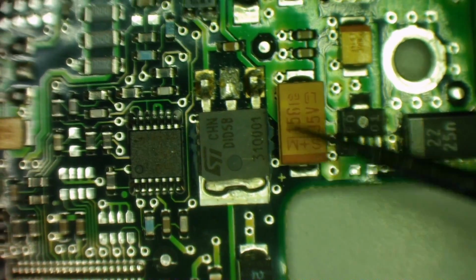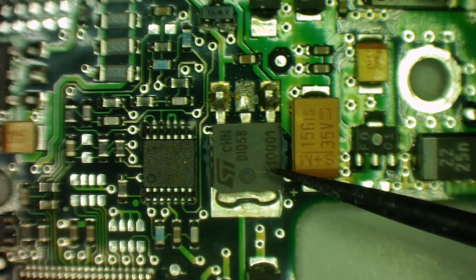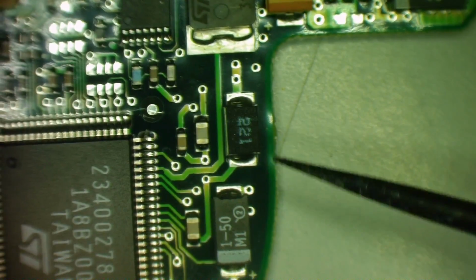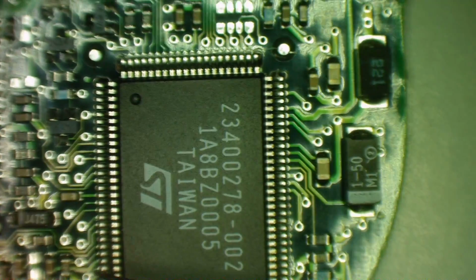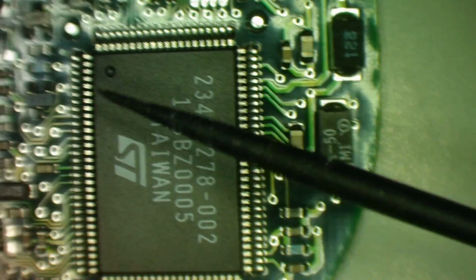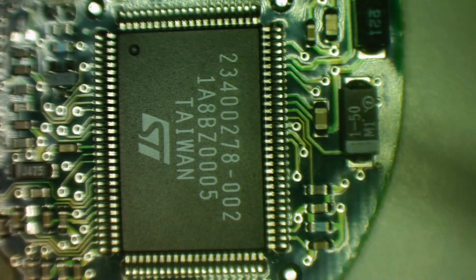And it says in the data sheet for this that this MOSFET is for DC to DC converters and for motor controllers, and I think that's what it is. I think most likely this just isn't trying to start, like possibly it's just a faulty motor controller. We know it's not getting hot and we know there's power on the board.